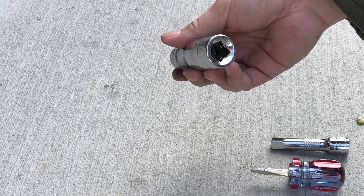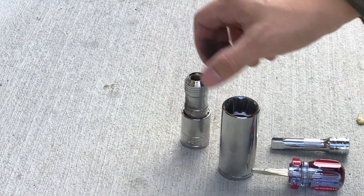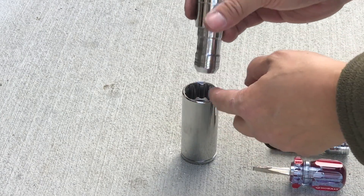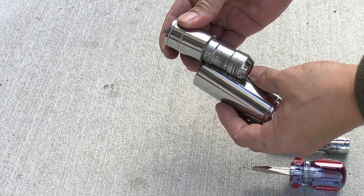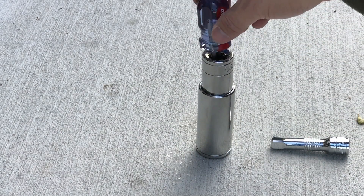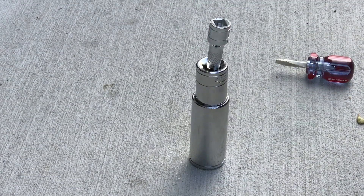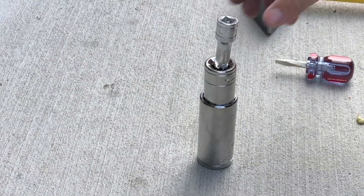It's about $2.50, so you'd spend $10 or so total. However, you can invest a little bit more money and get a deep socket. It's a little bit wider in diameter than the actual socket we used to take off the wheel lock. Your goal is to punch it right through and let it sit. It's a little bit deeper so the wheel lock can fall through. You can use a screwdriver to hammer it through, but I find it's more efficient to use an adapter for your wrench — it gives you more surface area. Just hammer it right through and it'll pop off. Ironically, this takes longer than taking off the actual wheel lock.